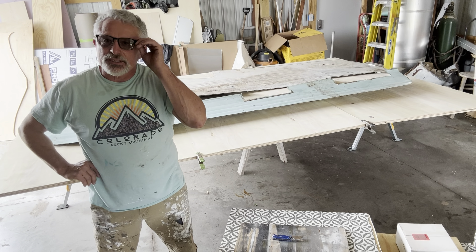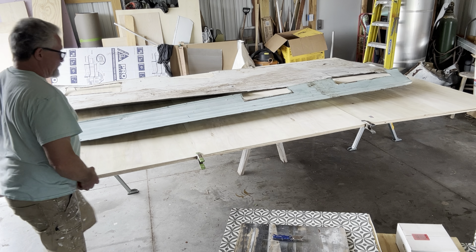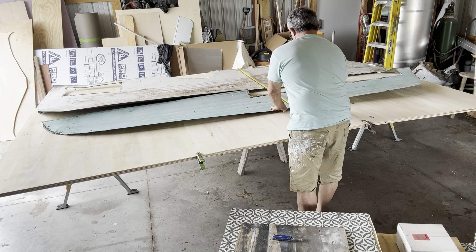This trailer, the 76JS, is 77 inches tall. I don't know if this skin is 76 inches tall, but let's get kind of close here and get a rough estimate. It's only about 69 inches. So I've got to come up with about 7 to 8 inches of plywood. I'll probably just move everything up the required amount and just have it go down straight for another 6 to 7 inches where it wouldn't have normally.